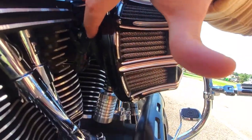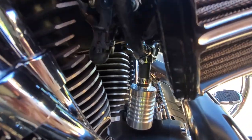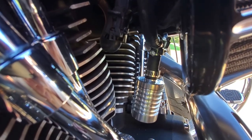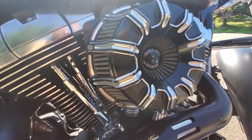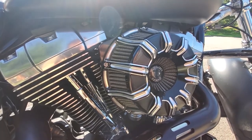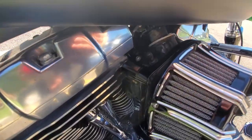1/4 inch, 3/8, 1/4 inch T, seeing as these two hoses that come off the banjo bolts have a 1/4 inch inner diameter. And then the hose that the catch can is attached to is a 3/8 inner diameter, I believe. And that's basically all it is. It's a pretty simple setup. The inlet tubes that are inside the breather are currently sealed with some Permatex gasket maker and some other types of silicone, and the banjo bolts themselves I had to drill out